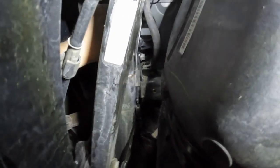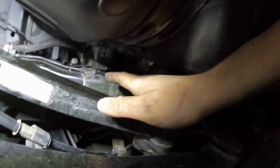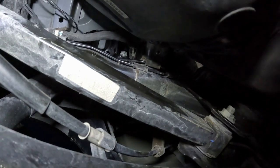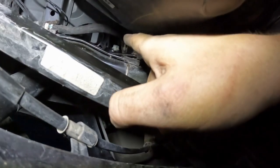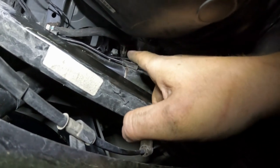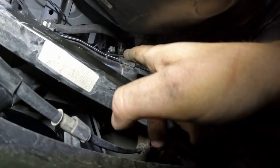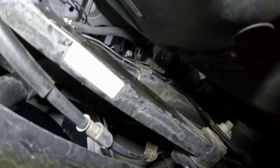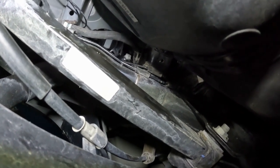This is the front left one by the fuel tank — it's really not as bad as people say online. It's just a two-bolt mount. Feed it from in front of the tank, then feed it back around the harnessing, then go back forward and thread the bolts in by hand. The harnessing is in the way a little bit and wants to grip on it, so it stinks a little. All hardware is 90 foot-pounds, all 18 millimeter.